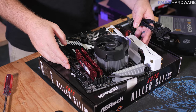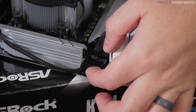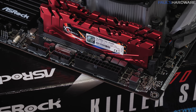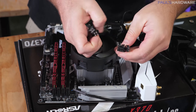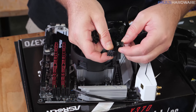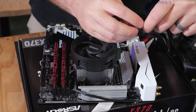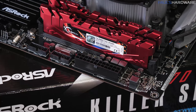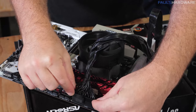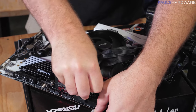For the outside-of-the-box test we need power to the motherboard. There are two main connectors: an 8-pin supplemental CPU power connector in the top left of the board, and the main 24-pin power connector. Both have catches so they only plug in one way. The CPU supplemental plug is 4+4, and the GPU supplemental power is 6+2 — both are blocks of eight but keyed differently. It's important to know both exist to avoid confusion, though it's challenging to accidentally plug a PCIe graphics plug into the CPU header.